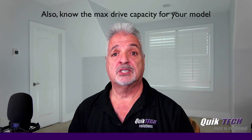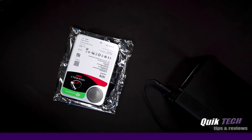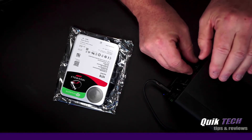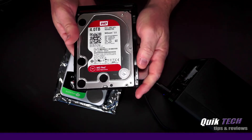Let's get started with the actual swap. Here's the DS216 Plus 2 currently running the four terabyte drives, and here's the first 10 terabyte drive. I've decided to use Seagate IronWolf NAS drives for this upgrade. I'm going to perform a hot swap, which means I'm going to leave my NAS on while I pull the first drive. Make sure you Google how to do this process for your own model, because some devices need to be turned off before pulling the drives. So I'm going to take off the front cover and pull out the first drive — and there you go, you can see it's a Western Digital four terabyte drive.